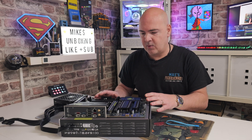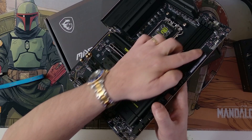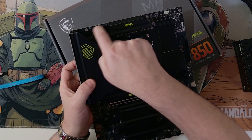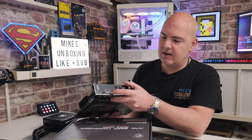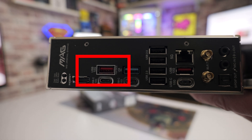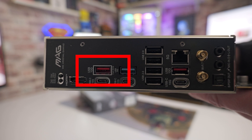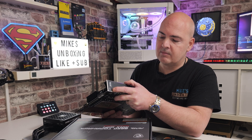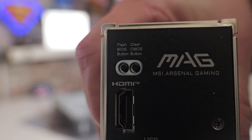Now we're ready to flash the BIOS onto the motherboard. Let me show you where the ports are. The main 24-pin power connector is here, and tucked away in the top corner are the two 8-pin CPU connectors — you can connect to either one. When it comes to inserting the USB drive, on the back of the board you'll notice a port that says USB 10G with a rectangle around the outside edge, and it says BIOS Flashback or BIOS USB on the side — that's the port for your USB drive. On top of the board there are two buttons: one for Clear CMOS and the other to start the BIOS flashback.